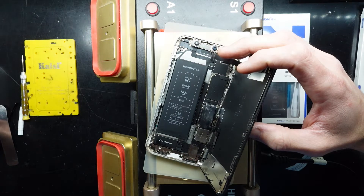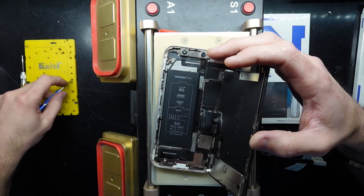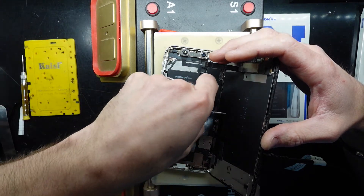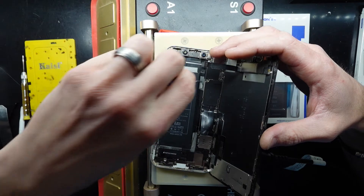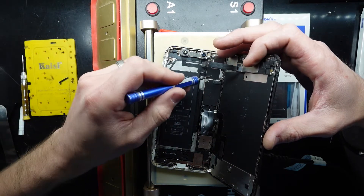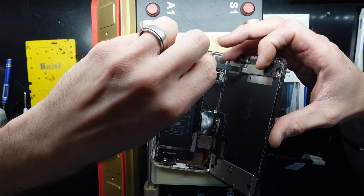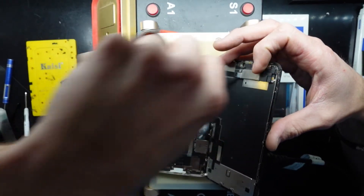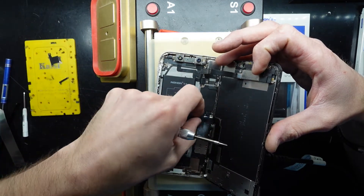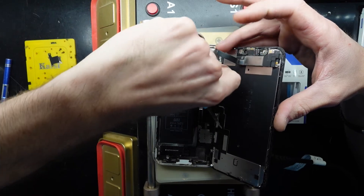As we can see, we have an iPhone 8 battery by Nohan in here. The customer says it's been operating just fine. This is a fairly rough-looking iPhone — it's copped a fair bit of abuse over its lifetime. First of all, it makes it easier if you remove the screen. Most screws should be the same — tri-screw, tri-screw, tri-screw. We are missing two, and then there's a Phillips head one up here.